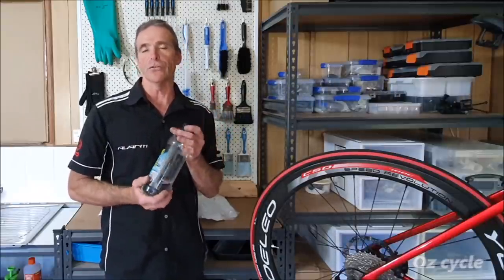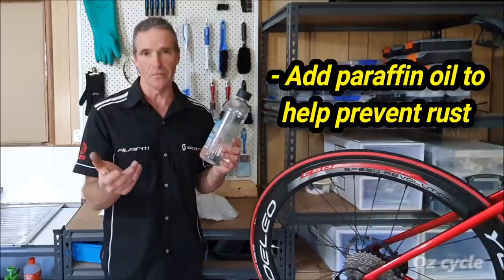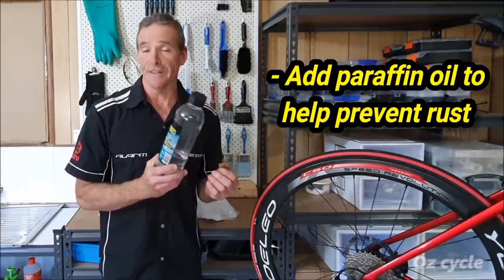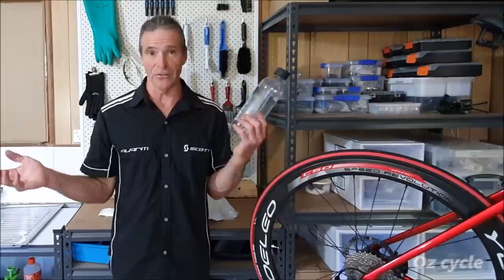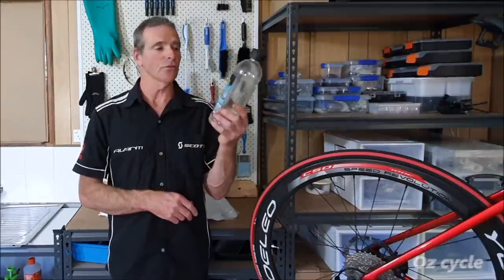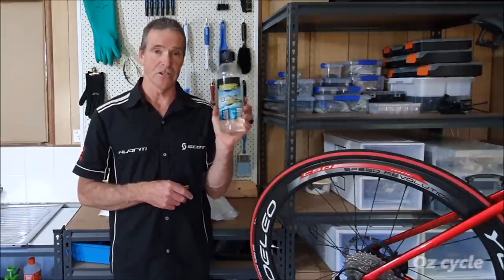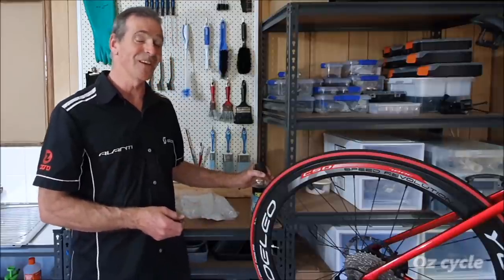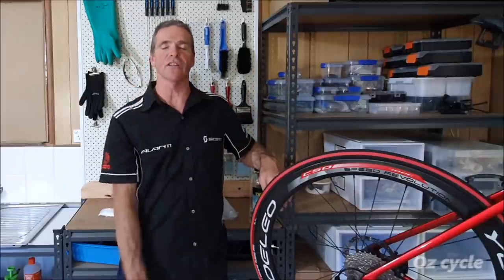So if you want — if you're riding in those sorts of conditions — add a little bit of paraffin oil, or make a separate batch with paraffin oil in it and put your chain in that. Then when it comes summertime again or good weather, you can go back to your dry wax — do the initial clean and then do your dry again. A lot of people also use a little bit of paraffin oil in the mix on their mountain bike because mountain bikes are usually going through mud and all that sort of thing, and that protects the chain a bit more than just the dry PTFE powder mix. Yes, you can add paraffin oil to the PTFE mix you've already made — no problem at all. For really good conditions, like we have heaps of in Australia, the PTFE powder on its own with no paraffin oil is great for summer — your chain looks lovely and shiny and clean all the time and attracts no dirt at all.